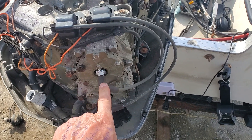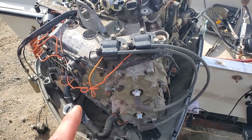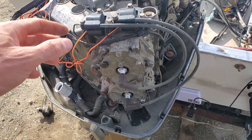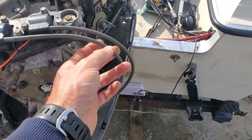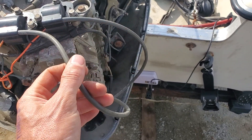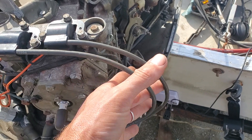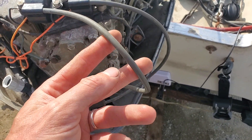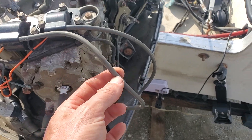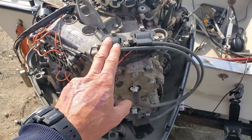The first thing you can do with a timing light on a running engine is see if you have a spark signal that's erratic — that's going to give you an indication of a cylinder giving you a problem. Now, you also have to make sure — I sometimes just clamp this into the socket — because if you have the inductive pickup for the timing light close to another one touching, sometimes you can get an erroneous erratic spark. So keep the wires away and hold this against the magnet in the pickup. Just make sure it's not flopping around, because now and then you might get a bumpy spark just because this thing's bouncing around. Try and hold the timing light steady. Go through all the wires and look for something that's just not flashing good.